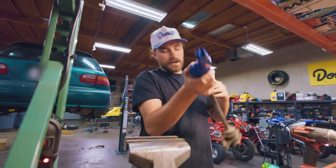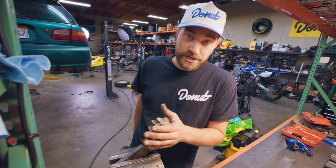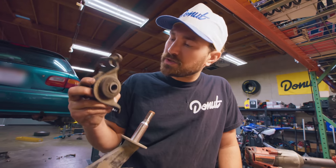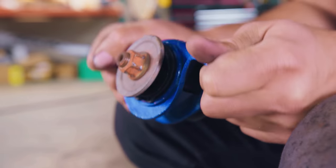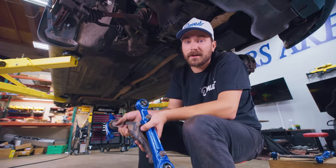Well, that was easy. Now flip this thing around and replace this bushing. Same thing here at the rear bushing for the lower control arm — it's rubber, so we're going to replace it with a spherical unit. That bushing looks like it's in fine shape, but even a brand new rubber bushing will deflect a lot under load. Not the case for these. We've got our front lowers put together, so they're the first thing that's going to go on the car.